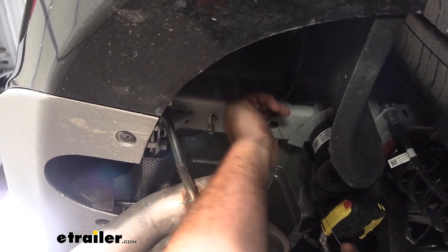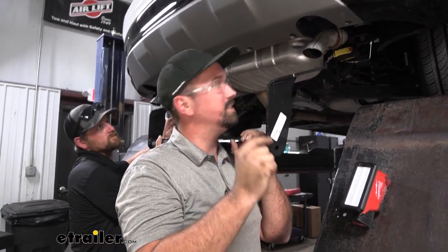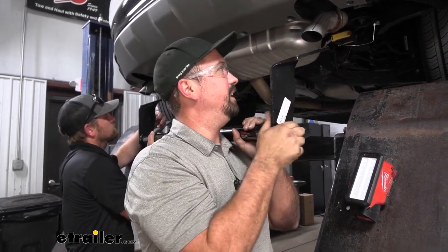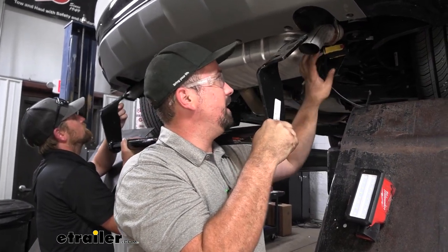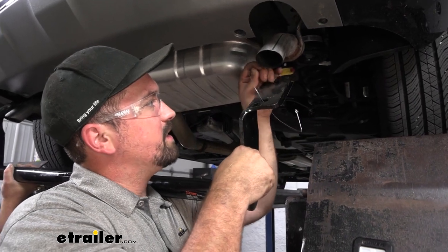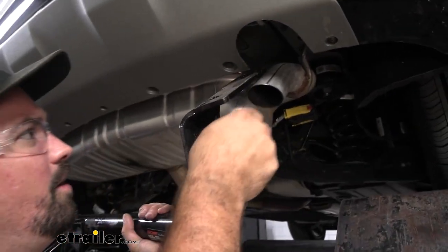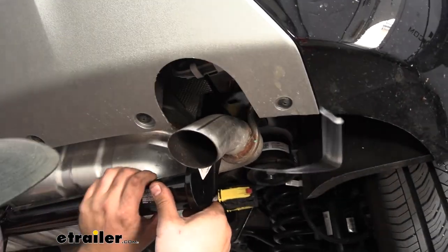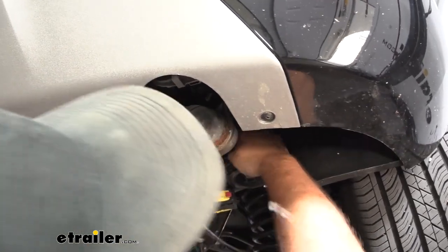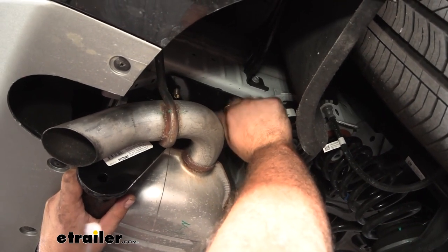At this point you're probably going to want an extra set of hands because we're going to slide the hitch up over the exhaust and get it in place. Make sure you have one of your serrated flange nuts ready — the goal is to raise it up, get the studs to pass through, pull off the fish wire, and get one started on each side so it's supported. The muffler is hanging down, which might make it a little difficult. Put a little bend in the fish wire and feed it into the corresponding hole — that bend will keep the wire in place without popping out. As you raise the hitch up over the exhaust, hold on to those pull wires and pull them along. Once raised, pull off the fish wire and get a few threads started.